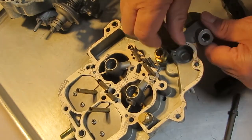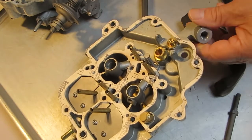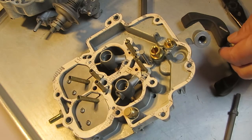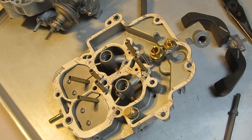So that's the auxiliary that I'm screwing in now. A lot of people refer to it as the secondary fuel valve. What it's for is under heavy fuel demands, the float will open that auxiliary valve and let more fuel in. We always stop that up or put a plug in it because Ford finally found out that it was putting too much fuel in the carburetor and flooding it out.